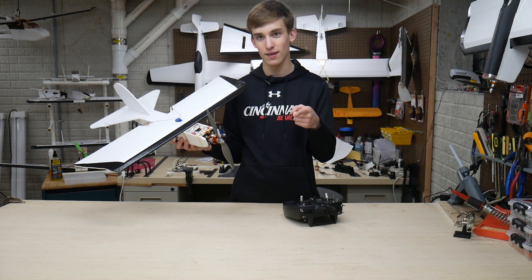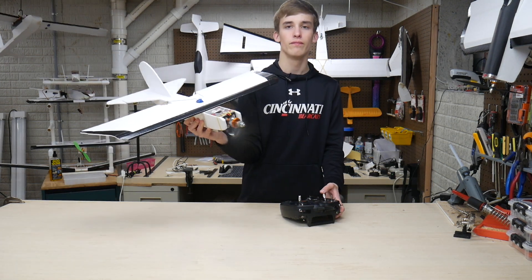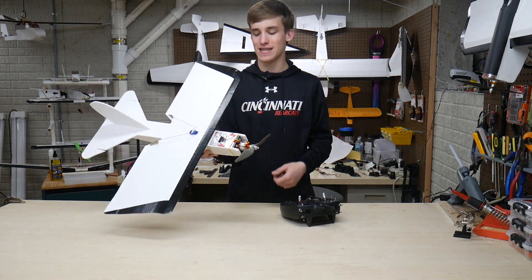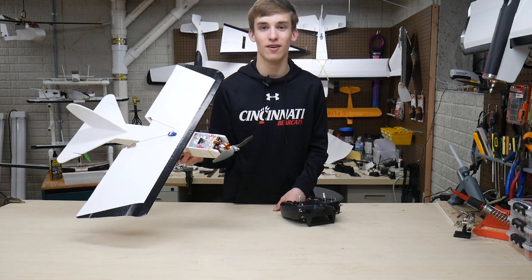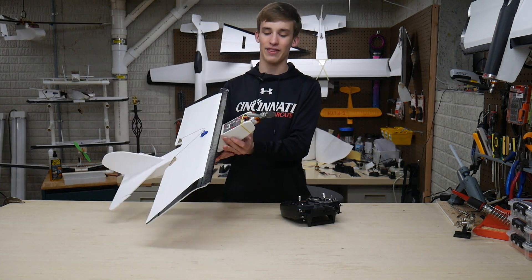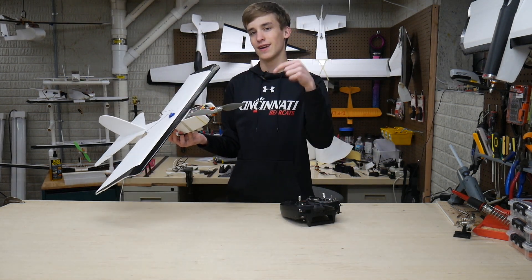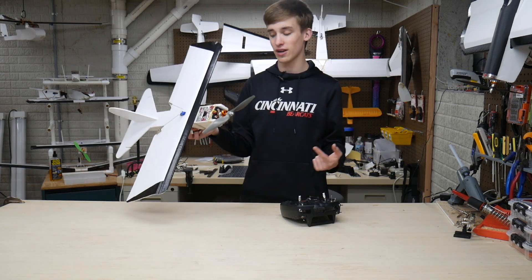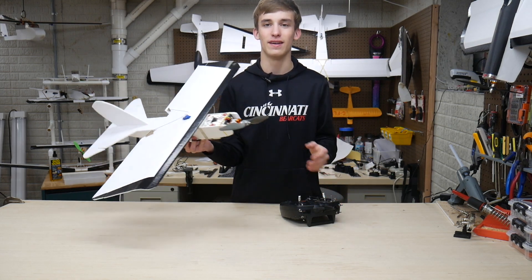You guys wanted a power test? Okay we can do that. This thing has got some serious power and I can't wait to get it up in the air because this thing is going to be a rocket. I've got to make sure there's nobody around me because if anything goes wrong it could be an actual problem. I'm a little bit worried — there's a lot of torque roll action going on, but I think it's going to fly well. Stay tuned for the next video. Again: 4-cell, 11x7 prop, DYS 35-36 motor on the Bloody Baron. I'm going to throw my tracker on there to see how it performs in terms of speed — it's going to be crazy.